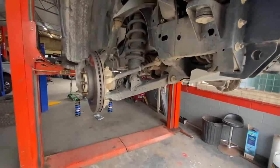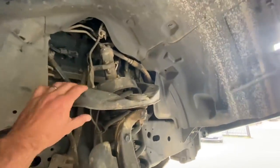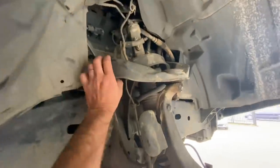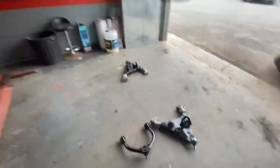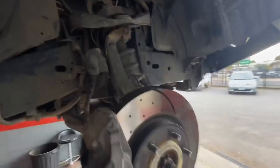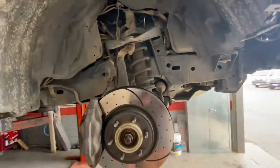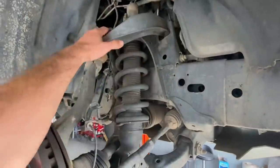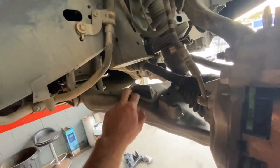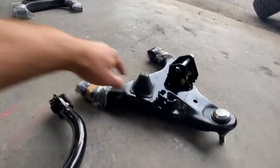You don't have to do upper control arms but it's not a bad idea. The factory ones are quite big and chunky but also quite light duty - just pressed metal. What we end up doing is either a Dash or Blackhawk upper control arm, which has a ball joint that can angle slightly more - an extra 15 degrees, nothing huge - and you do get a little bit more droop. Note the bump stops: the factory bump stop needs to be changed to the extended bump stop on a lifted car.